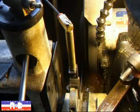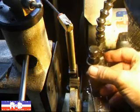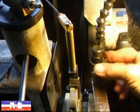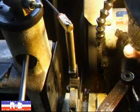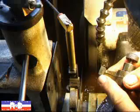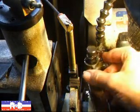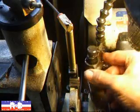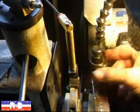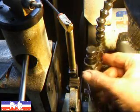What I did was mount this on an adapter and put that in the fixture here. You can see there's still a little bit of damage here. This is out of a little '64 Mustang, and after so many thousands of miles the rocker arms would still wear like this, and we have to refinish these so that they can be reused once more.